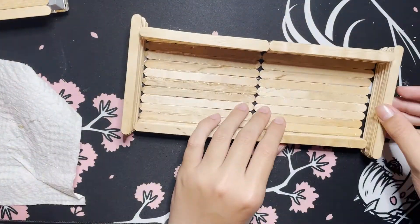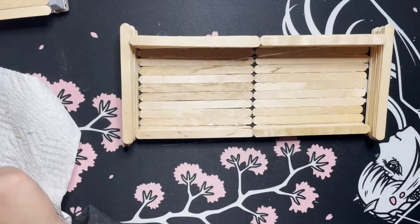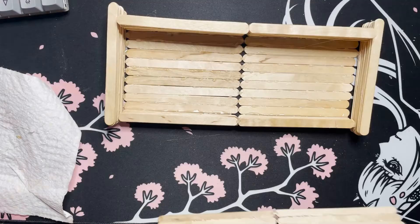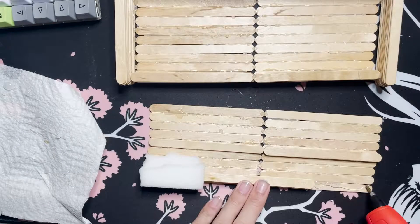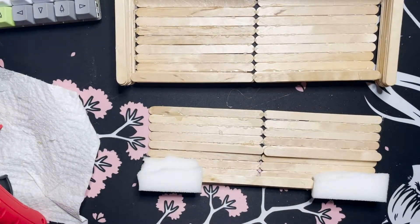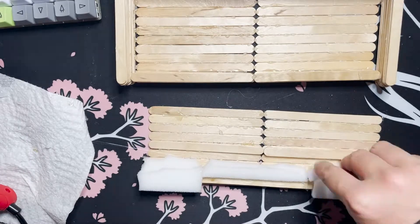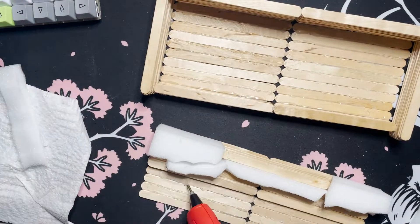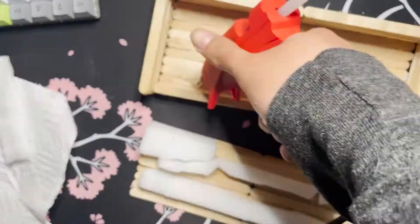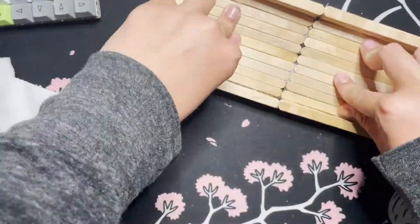Once all the sides were built, I was ready to place this angled piece within the outer casing of the keyboard. Since I created the higher and fuller profile of this board, there was a concern of a hollow sound when typing. To solve this, I put foam in the areas of the case where there would be the most empty space and thus the most prominent echoing. I think I did pretty well, but at the end of the day I guess it's up to you guys, the viewers, to tell me what you think.